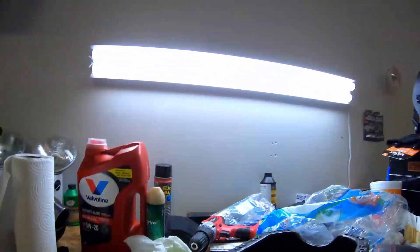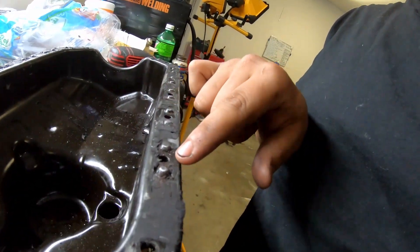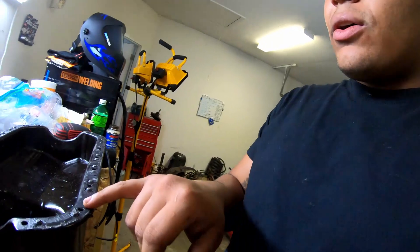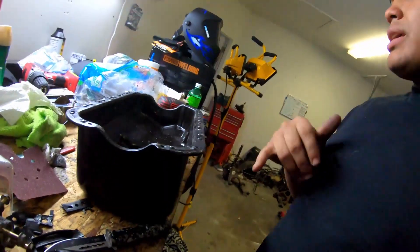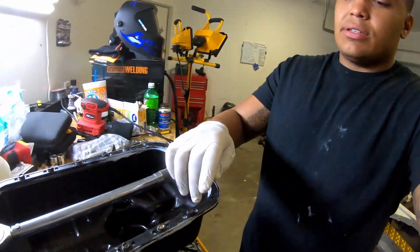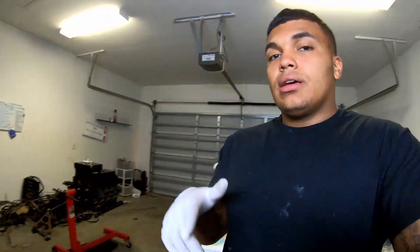Back in the garage. We ran into a problem last night where we couldn't get it done. Whoever installed this oil pan gasket last used way too much RTV and it left all this little debris off the gasket — came apart in pieces. So I had to get all this gunk off of here so the new gasket will lay down and make a good seal with the pan. I just finished laying this new gasket down, got it RTV'd where it needs to be, just have these screws in place to hold it while the RTV sets. About to take these out because it should be dry enough, then bolt this oil pan on.